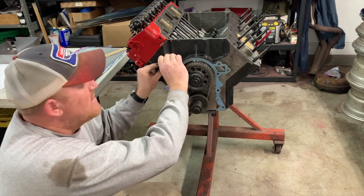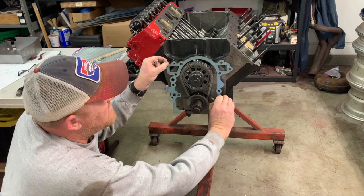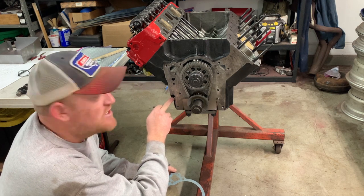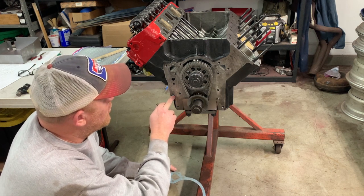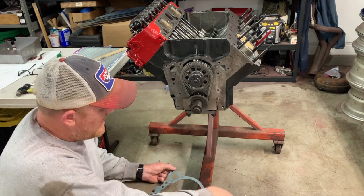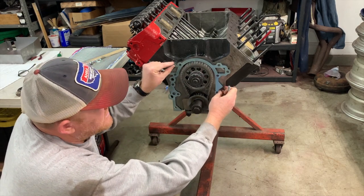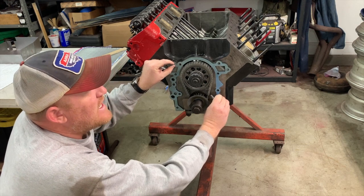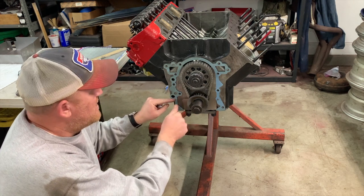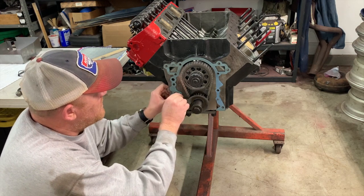Both of these passages have been opened up for oiling purposes because this engine is going to see a lot more RPM than the factory 5,200 max - it should be around 7,000 or so. The oil suction side passage is considerably larger than factory. The feed passage is 9/16, this one's 5/8, so the gasket itself has to be opened to a larger diameter so it doesn't restrict the oil flow we've created in our pump. If we don't open up the gasket, it was all for nothing.